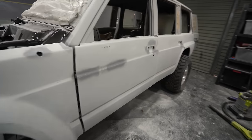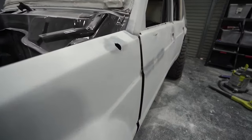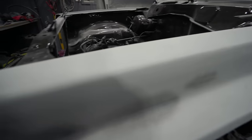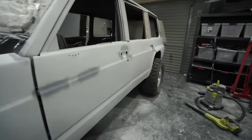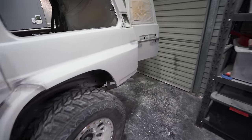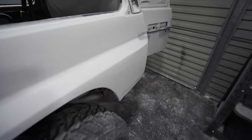You can see the panels are nice and painted. It is really nice to see this car finally have some real paint on it that's not flaking off. The panels are super flat — I can't see one little nick or scratch. Although I know when we paint it, it's probably going to show up more imperfections. The car is not going to be perfect but I'm trying to get it as close as I can. I also went ahead and re-bogged up this corner — when I painted it with the primer, the edge was really round and didn't look right. So I've re-bogged it and shaped it up so it looks a little bit more factory.